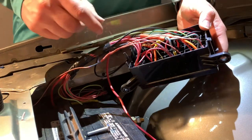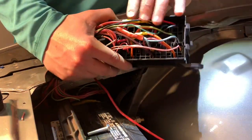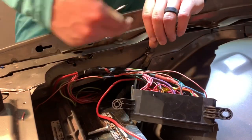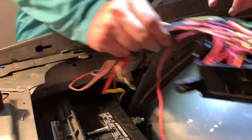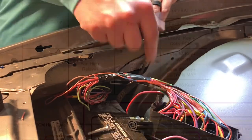I recommend running all your power wires first before you start putting your signal wires in, and before you put anything from the PCM in there. I ran all my stuff down my fender and in right here — I have plenty of length so I have plenty of room to work on it and to service it later on.